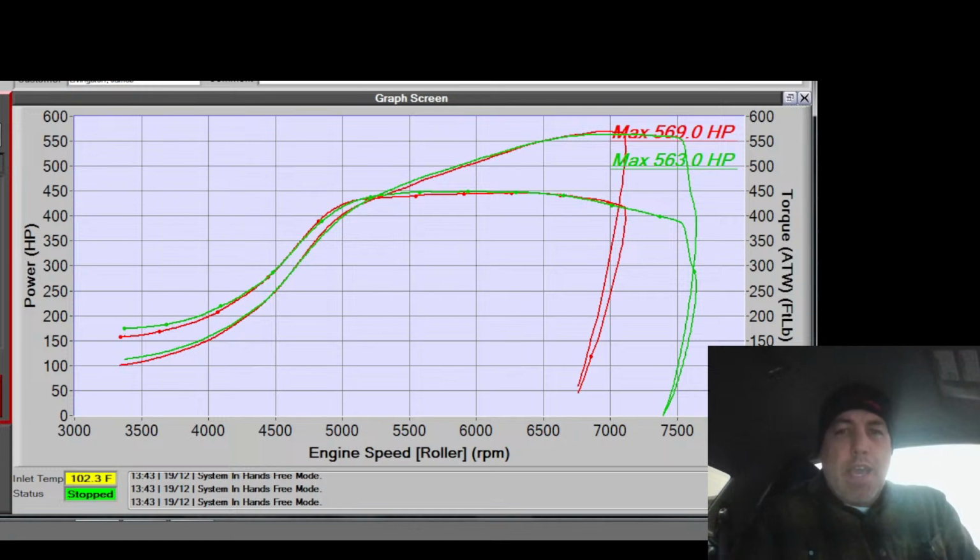Alright, so I have ignition timing at, where's my peak boost at? Let's see, at 4,500, 13 degrees, 5,000, 13 and a half, 6,000, 17 degrees, 7,000, 21, 8,000, which we didn't hit because the throttle closed at 76, 25. Is that right? Is that when it started to close already? It looks like that's when it started to close already. So 24 and a half.